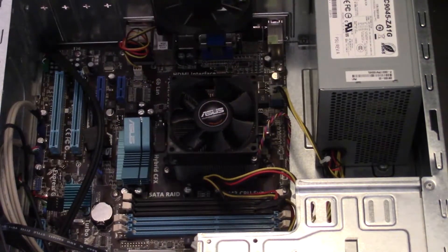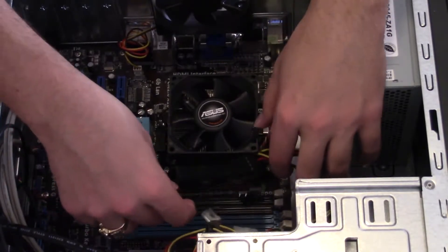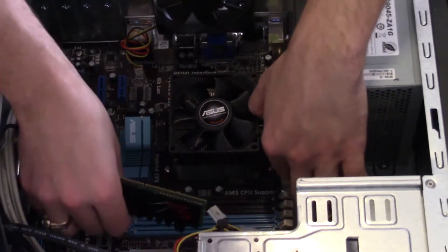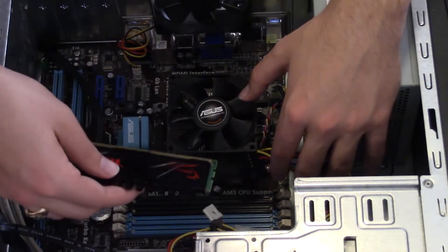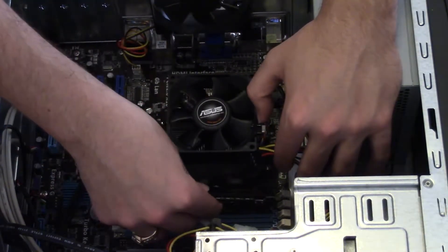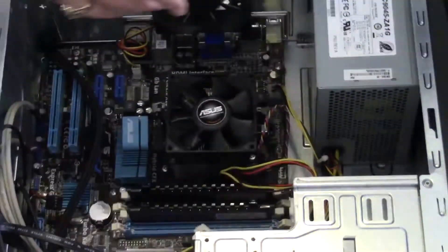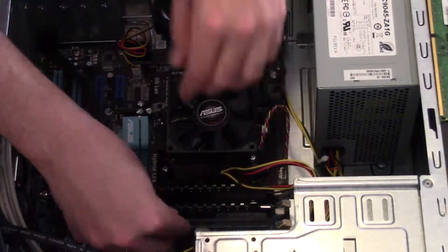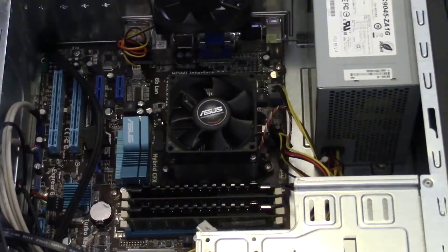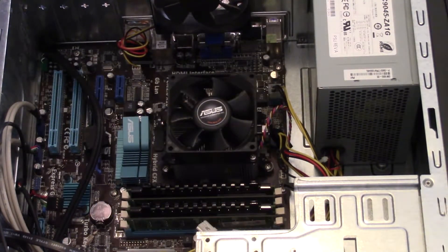Hopefully all of these work — I think they all do. Let's put them in. It should be about eight gigs of RAM. They're not ECC so that's not ideal, but we'll line the notch up. That's all plugged in — we just need hard drives. Plug those in and hopefully get it started.